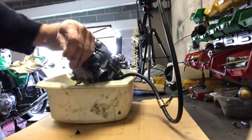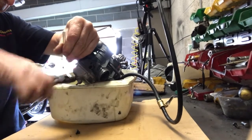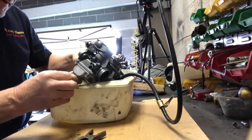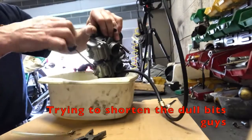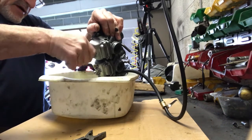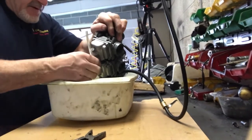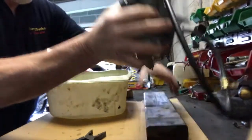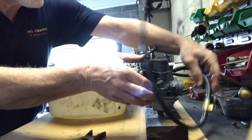Let's fill the carbs up and see where it ends up. That carburetor — the height of that should be level with where the point of my screwdriver is, and it's actually almost up to the joint there. So that's telling me that one's high — I'll mark it H. I'm going to drain this one now and move on to the next one. I'll pop the plug back in and put the pipe in there, and we'll do the same mark on the same carburetor.